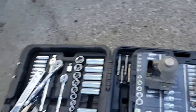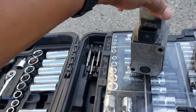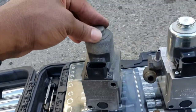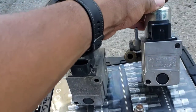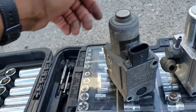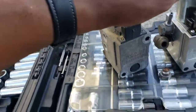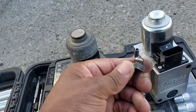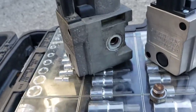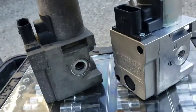They was telling me I had a bad VGT. So it kind of sucks that I'm not able to really say, okay, this fixed it, or them two sensors fixed it. But I'm replacing the VGT actuator, taking the old fittings off and putting them on the new one, and this little bolt stripped out. The threads came with it, so I gotta take it back. I gotta take it back anyway to get my money for the core. And then I need a new bolt for this. And this bolts up right here. Once again, it's quick and easy also.